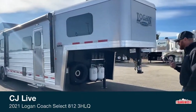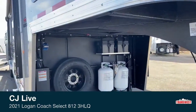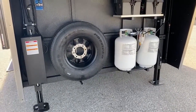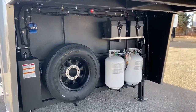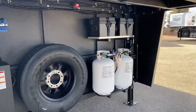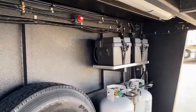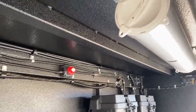We'll walk you through this trailer and some options we've done on this. This is a Logan Select 812 three horse LQ — eight foot wide, 12-foot short wall. Underneath here you'll notice we optioned to go with the dual jacks. The reason is the length of this trailer. This also has a slide-out, so with that we'd like a little more stability with the dual jacks rather than a single leg, so you can manipulate how this trailer sits and get it more level. We upgraded to the 30-pound LP bottles to give a little more capacity — not having to change those 20-pound bottles near as much. And all this vortex lining underneath here.